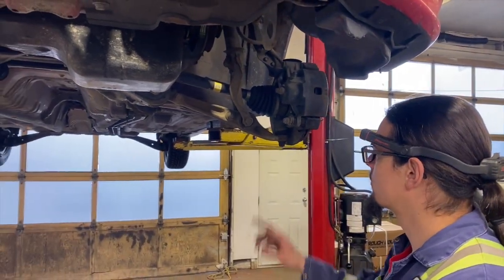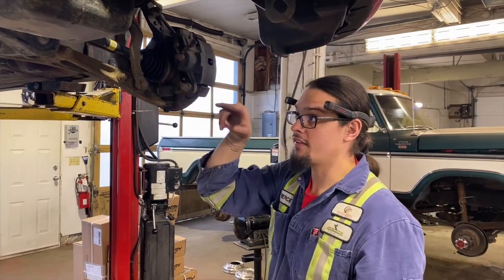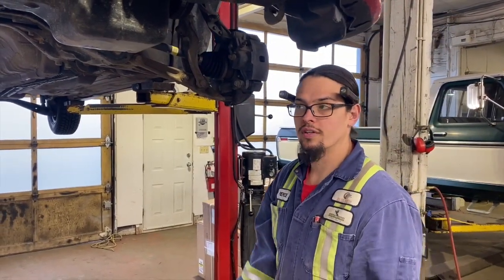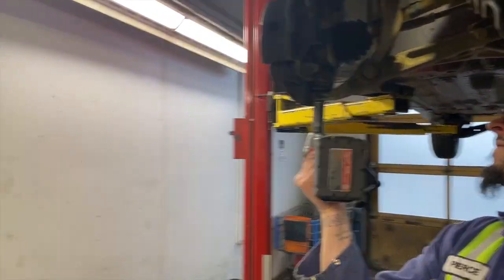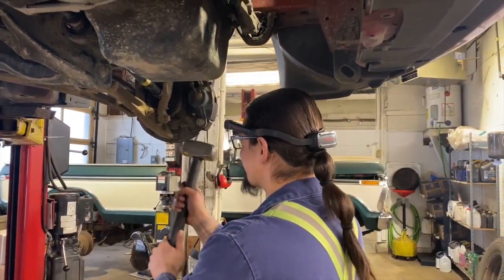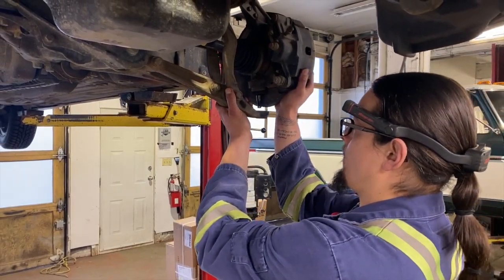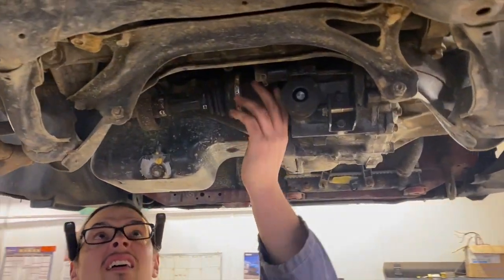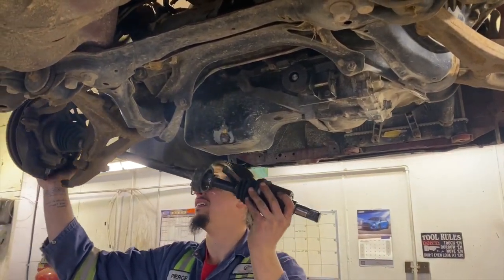Now we're gonna get our CV shafts out, so we're gonna undo our ball joints. And I believe on this side, just with the amount the upper ball joint has, we're able to get the CV shafts out far enough. I mean, we don't use these CV shafts on the K-swap anyways, so we might just tear them right out, but our vehicle also has to roll in and out of the shop often, so I don't know what we're gonna do yet. Pop that out, and then we'll just give this a little jar, like that. Just like so.